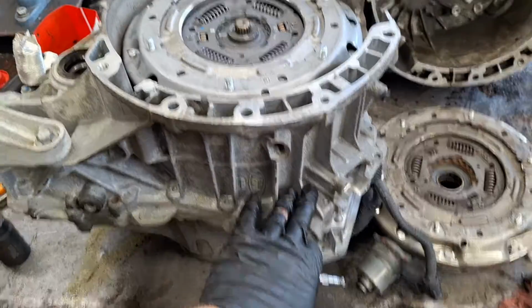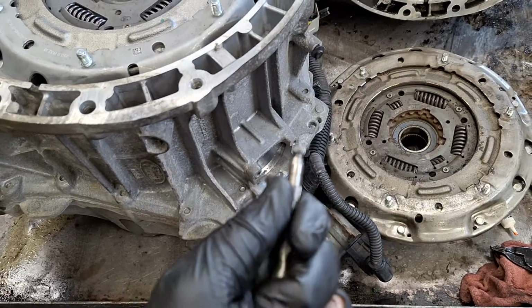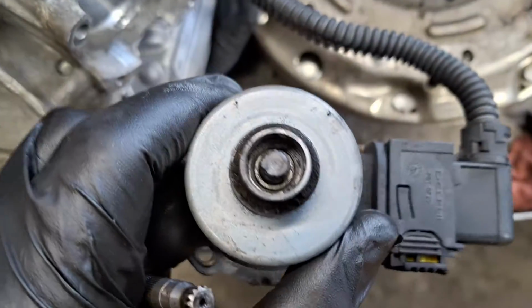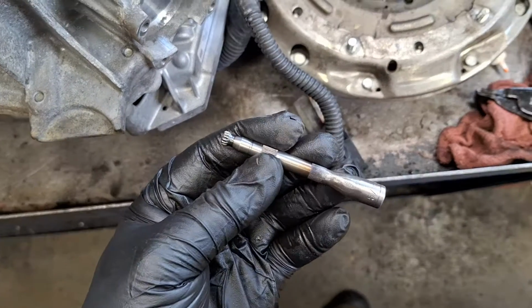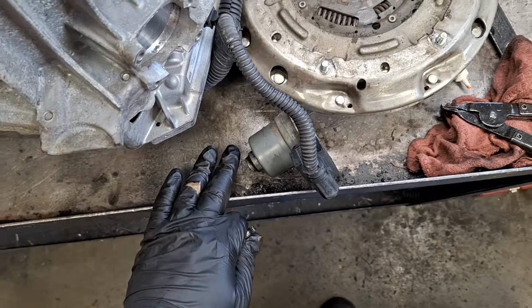Next thing you want to do is unlock your new clutch. Okay, so you have a few different options here. Here's what the special service tool looks like. It's literally the same splined gear that is found in the actuator motors here. If you bought new motors, you can take the old one apart and kind of do what I did here and weld a socket onto the end of it. But let's keep welding out of the equation.